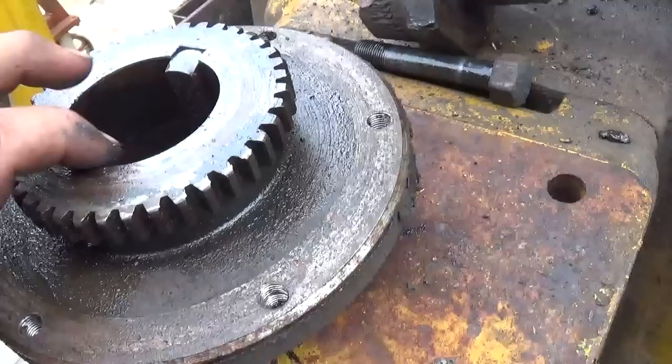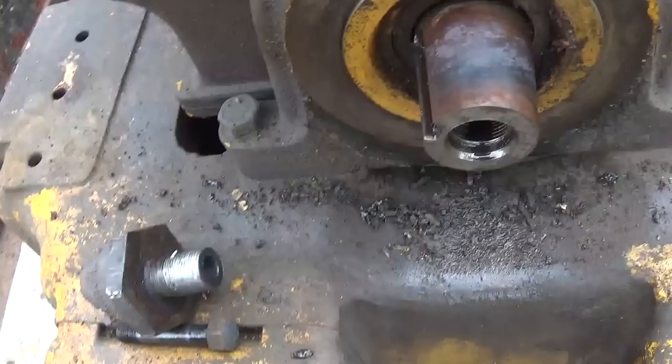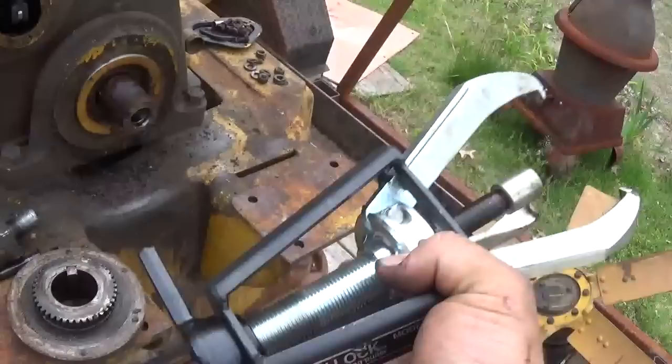Last is the hub — the pulley hub itself. I don't know what this gear is for; some application other than what this engine is being used for — it wasn't used. It's a tapered fit on the crankshaft, and to my surprise, with just a small puller, it pretty much hopped right off the shaft. There's some rust on the taper so it wasn't seating as effectively as it could be, which probably helped me out a lot. I used this little three-jaw puller here — I really like these Posi-Lock pullers. Probably the best three-jaw puller you can buy in the sizes available.